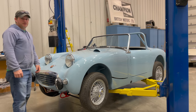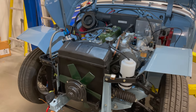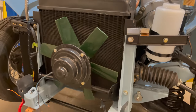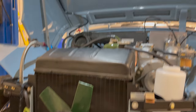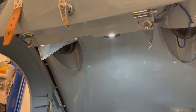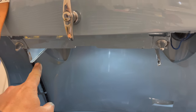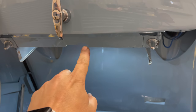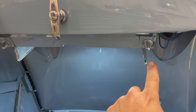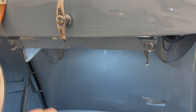First I'll bring you up to speed with some of the things I've done since I last showed this car. The first thing you would notice that's changed is I do have the fan mounted here now in front of the radiator. Some of the bonnet had to be trimmed in order to fit that — it used to come out further, and a little spot for the motor needed to be trimmed as well, with these pressed out slightly in order to clear the fan and the motor.